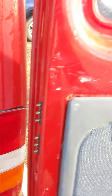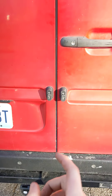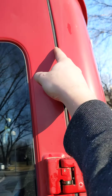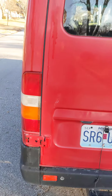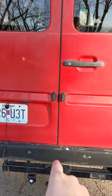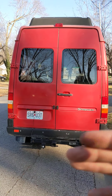When you're replacing hinges or doors, it can be a real art to get these to shut correctly and to look good on the body. What you're looking for is you want to check the gap at the bottom of the door and the gap at the top of the door — you want them to be the same. If you see a spot that's narrow or wide, it tells you that one of these doors is out of adjustment. You can tell which door it is by doing the same check on the other side and comparing. Make sure when you initially set the door level, you want the bottom guide to be kissing the bottom strike plate — that will get you in the general area of where you want to be with having your doors line up and close correctly.